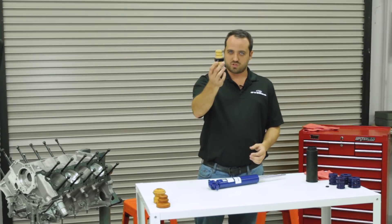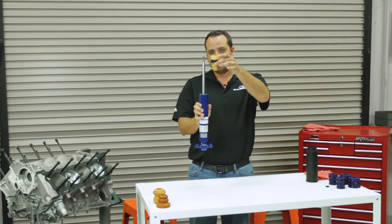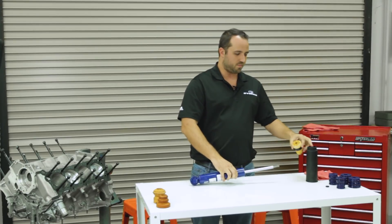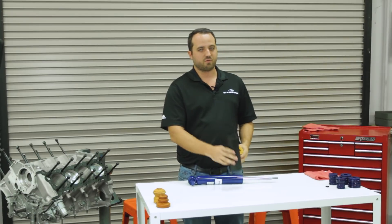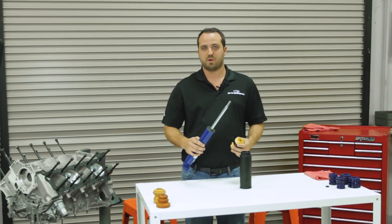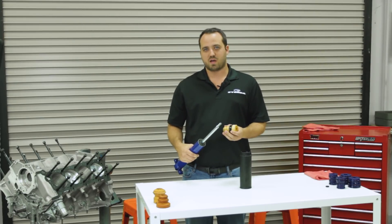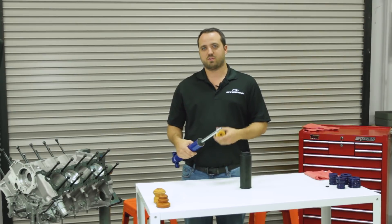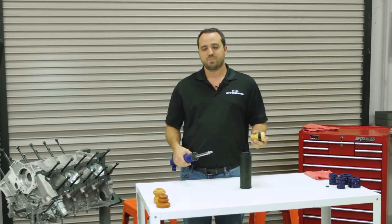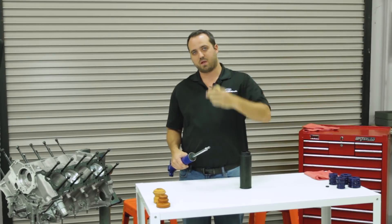This week we're going to focus on the rear bump stops. This is what your stock one looks like — it fits on a stock shock. I've got one of our Steeda Pro Actions right here. It sits underneath the dust boot and stops the shock from going too far down and causing damage. With a stock suspension it's about only an inch away from the bump stop on stock springs, which is fine if you don't have lowering springs or aftermarket shocks. The problem is when you lower it, it's sitting on top of this all the time, creating an artificial spring rate.